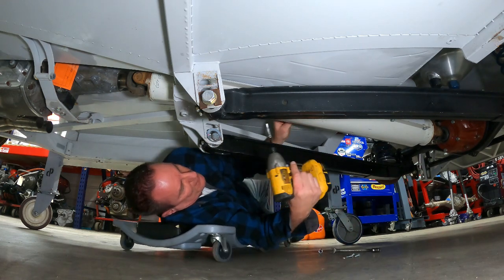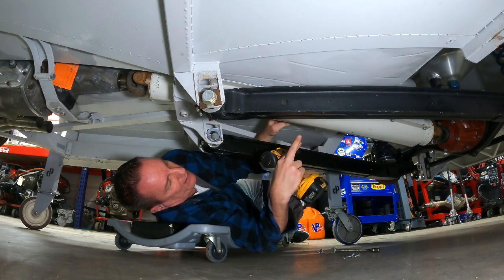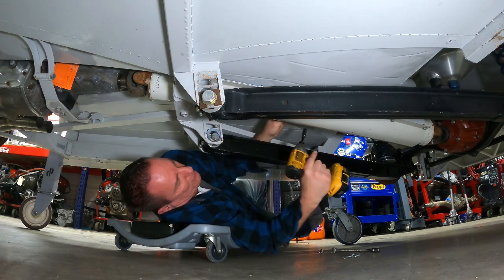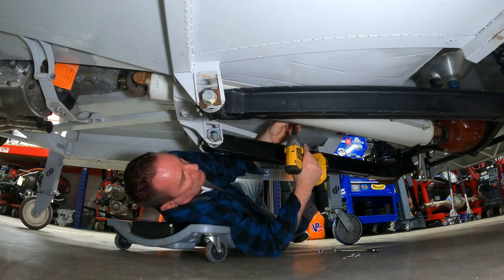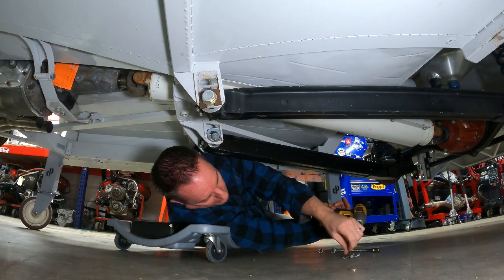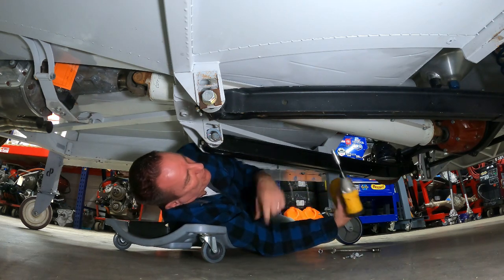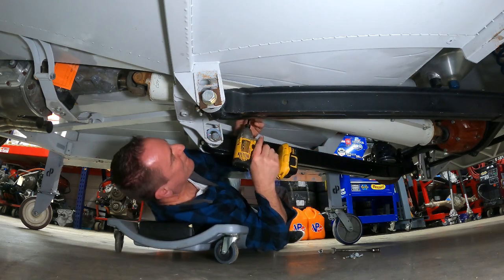Basically what that means is it's not a COT chassis, it's not correct for the body, and that they have chopped the halo to raise it and put a fiberglass body on it as a show car. There's no way that a car raced as a Gen 5 or Gen 6 car without that solid hard tunnel underneath it.